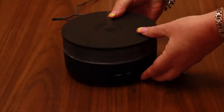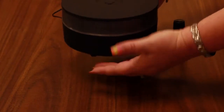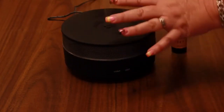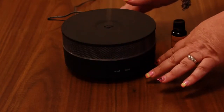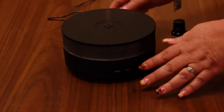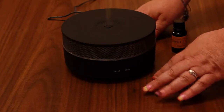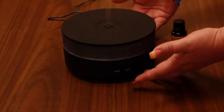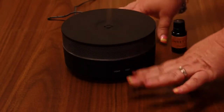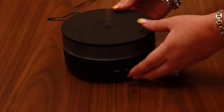You can run this unit with just the lights going, just the mist going, or both at the same time. While the unit is running, there's a little vent right underneath it — make sure you don't have anything blocking that vent. You will get some condensation on top of the unit and on the table around it, so if you want, place a thin dish towel underneath to soak up the condensation. Don't use anything thick because it'll block the vent and you won't get the mist.